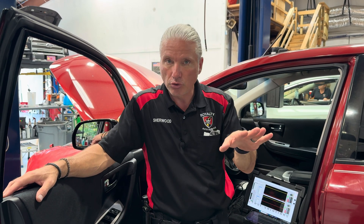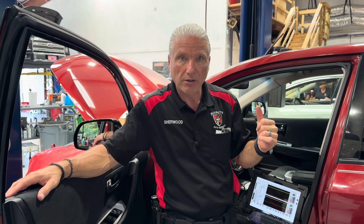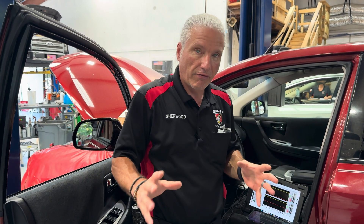This vehicle came in with an intermittent hatch not opening. The thought was that the latch was no good in the hatch, and the reason for that was because the relay was functioning — you could hear it click and supposedly you're getting power back to the latch. I want to show you how we proved with a scope that it was not the latch, but the relay. I've got a new relay already, and the old relay is still in it, but I want to show you what's happening and how we can catch that with a scope fairly quickly.